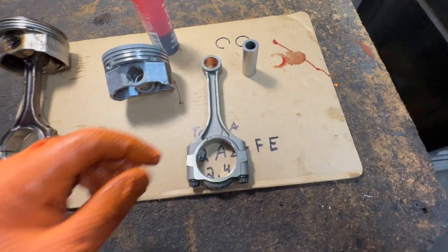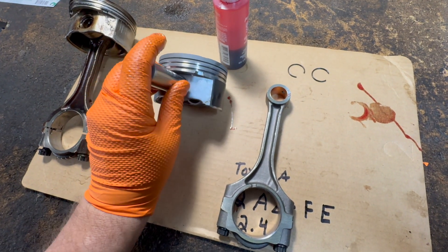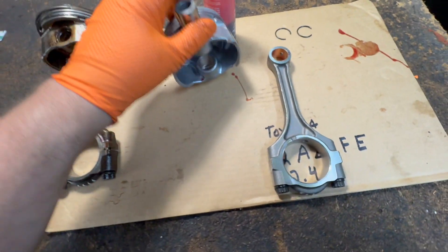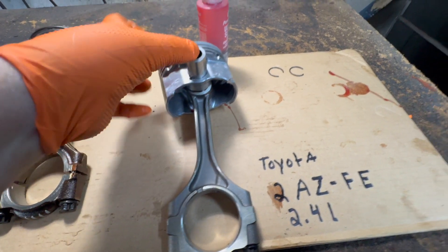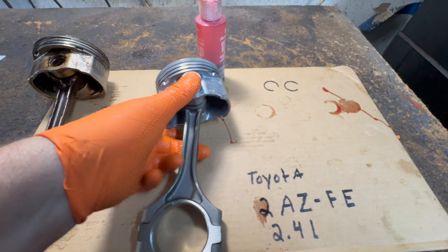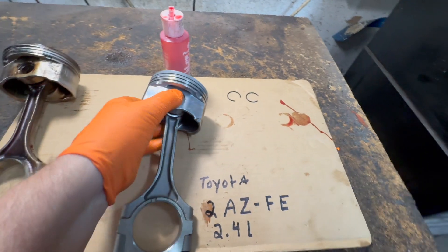Down and down. Now you just push the piston on — the piston pin. It's very, very tight tolerances. You don't want to force anything as you're putting it in. You slide it in and you can wiggle it a little bit. A little thumb pressure is all you need — you see how it slides right in nice? It should not bind at all.